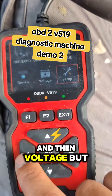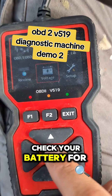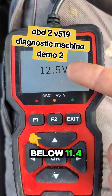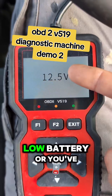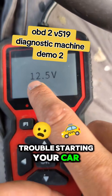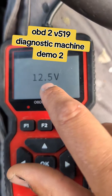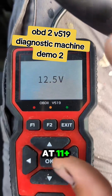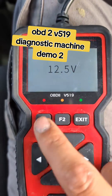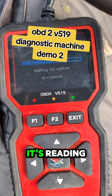You can also check voltage — so you can check your battery, for example. If it's below 11.4 volts, generally you've got a low battery or a dodgy alternator. So if you're having trouble starting your car, do a reading: 11 volts plus and you should be able to start the car. So there's nothing wrong with my alternator and nothing wrong with my battery — that's all good.